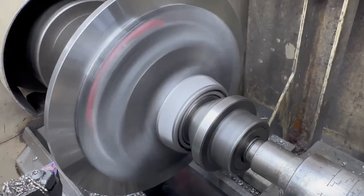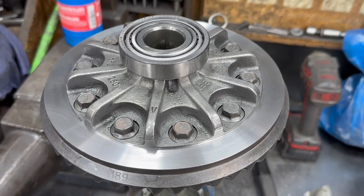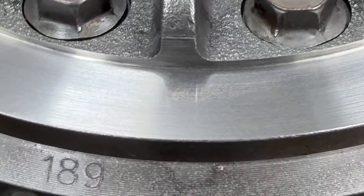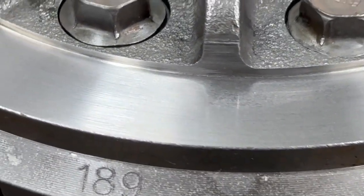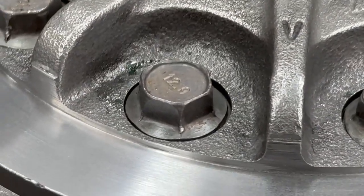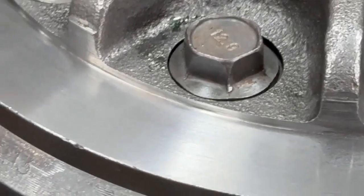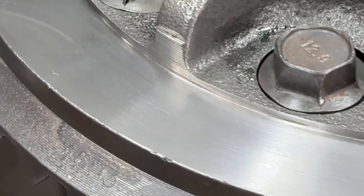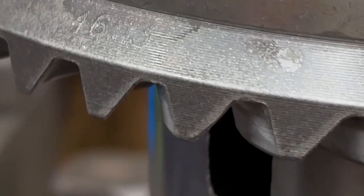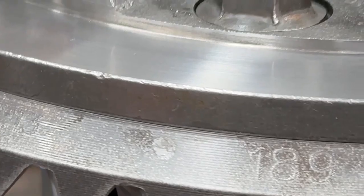Here we're putting a finishing cut on the modification we have to do to peg a short nose — we basically just flatten it off to give us room to cut the pegging pad. The four pin is now machined. The flat area there is where it's been through the lathe. It's still supporting the back of the crown wheel. We've got the 12.9 grade flanged head bolts that fit in there perfectly — and that's where the pad sits. It's still got that thickness there supporting the back of the crown wheel, which we think is a better solution than just munching it clean off.